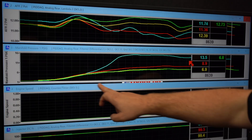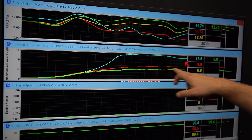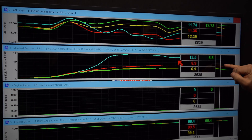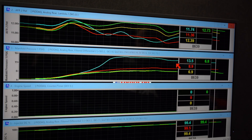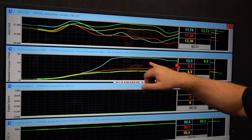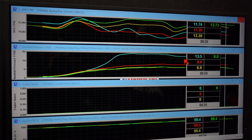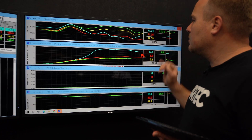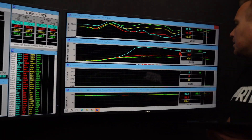Now I'll quickly show those boost curves. You can see the boost really comes on much harder with the harder wastegate spring. Previously down here you got 6.9 psi with the cooler added but no water, then we got up to 8.9 psi — previously it was about 10 psi — then we raised it up to a peak of 13.5 at the top end. Earlier it was sitting at about 15 psi, and that's where we're experiencing some clutch slip, so we can't really continue tuning until we sort that out. But yeah, we'd like to try and get that boost a little bit flatter and see if we can exceed 300 kilowatts on 15 psi, which is what I'd like to see.